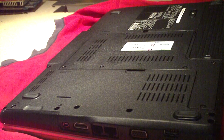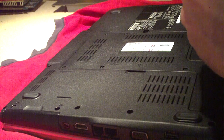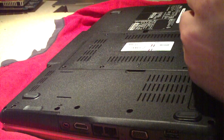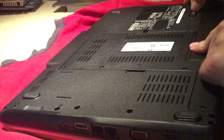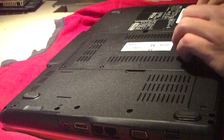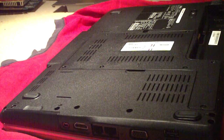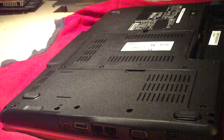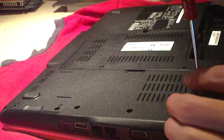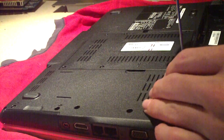But on this laptop you can replace the CPU without having to even tear it down. All you do is take off these screws — there's a lock screw in this area but I've already removed it. Also don't forget to remove the battery before doing any serious repair work on a laptop. The battery just pulls right out. Continue on removing these screws; they stay in the door itself that covers the interior of the computer.